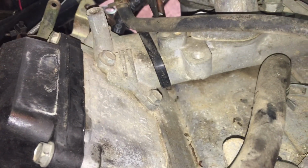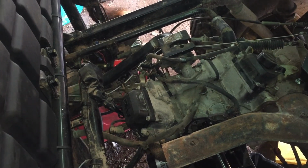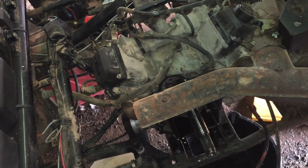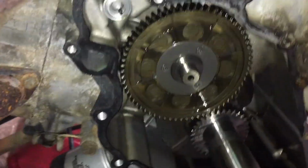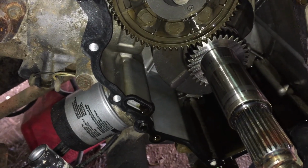The gear looks to be in good shape. I'm not gonna mess with it. If I end up having to, then I will later on. But it's in good shape now, and it's about $200. They make a metal gear, but you got to replace several other things. You have to replace the crankshaft gear. Well, I guess it's a whole metal camshaft, and I think you'd go ahead and put new tappets, lifters, in it as well, since you're putting a new camshaft in it. So all that together is like about $200 worth of stuff, and this gasket set was $14, so we're just going to do the gasket and not worry about the camshaft gear until we have an issue with it, because right now it is fine.